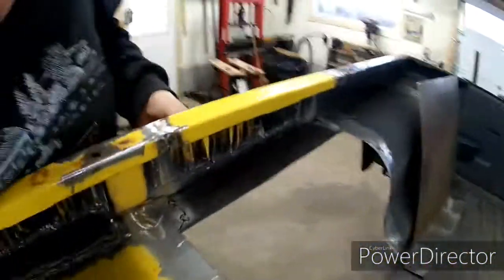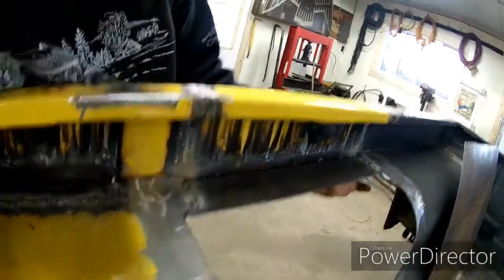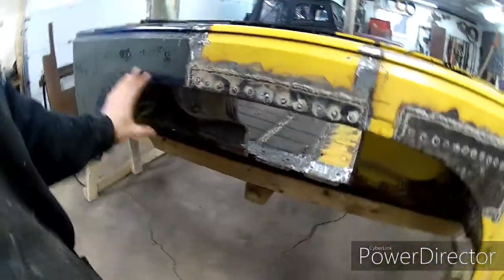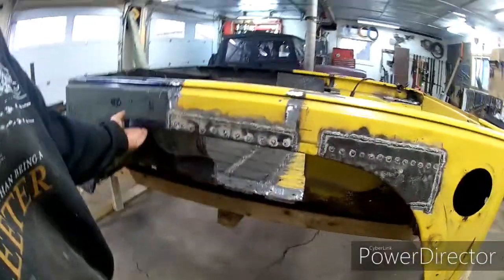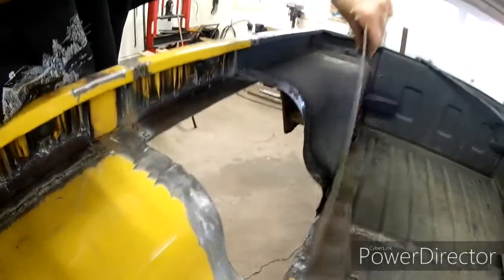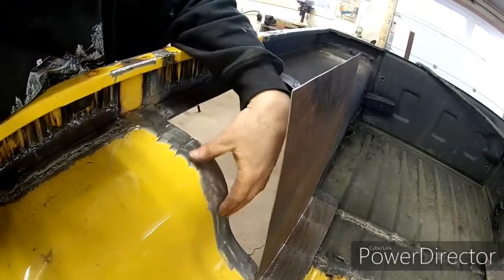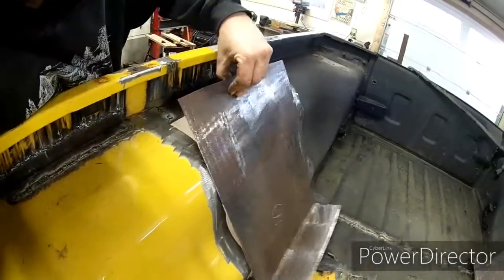On the sides over here, underneath the fender we wanted to rebuild this section to give it strength on the outside. This follows all the way across and is going to get covered in checker plate. When that happens, we're going to reset the wheel well where we want - we didn't want to lose this rib all the way around because it gives it strength. We'll patch this piece back in, and then on the inside we've got this patch which we're just going to let overlap just a hair. We're going to bed line the inside of this box anyway, so this piece will come up and lay right on top. That's a job for another day.